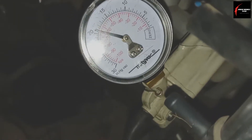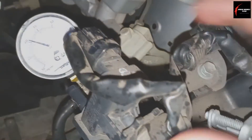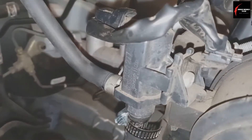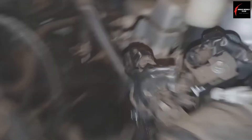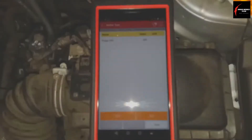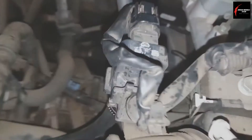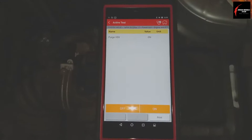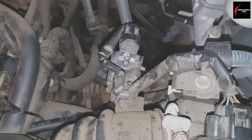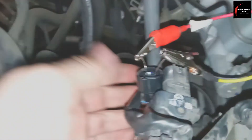There is a second test you need to do with the scan tool, which checks power and control — to see if you're getting power to the electrical connector when you do a bi-directional control. I'm testing this canister purge valve on the Toyota Corolla with my LaunchPro mini scan tool hooked up in actuation mode to test the function of power and control of the purge valve. I press the on button to activate it and you can hear and feel it ticking, which tells us the computer is in control of this circuit and the control side is working beautifully.